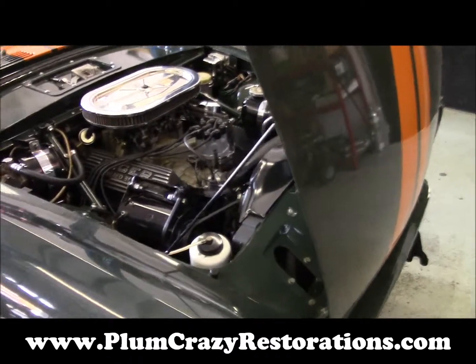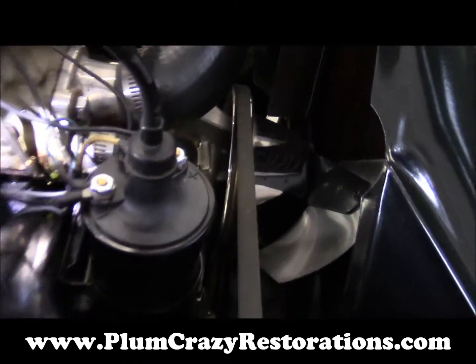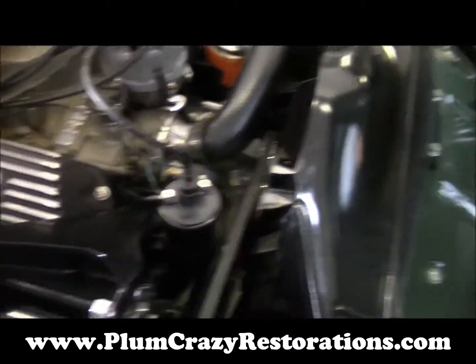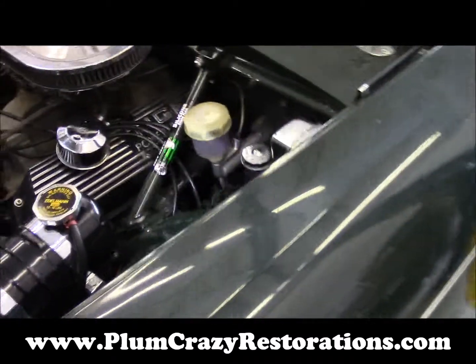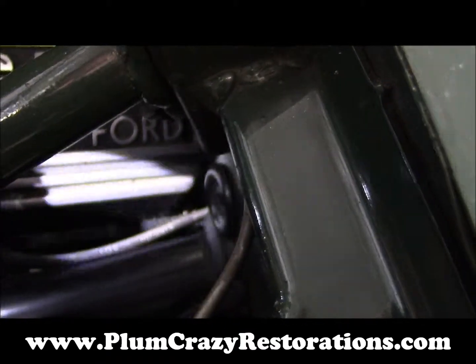Looking at the top side of the 1964 Sunbeam Tiger, we have a coolant leak from the thermostat housing — not too bad — and we've got some oil leaking around the valve covers, so we want to come in and reseal those.